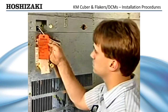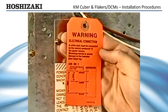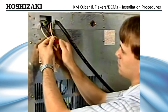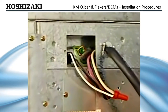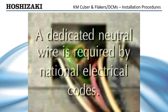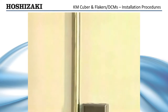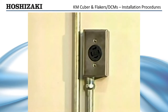When making the electrical connections, it is important that they be made in accordance with the instructions on the warning tag provided with the leads in the junction box. Make sure the white leads are connected to the neutral conductor of the power source. To prevent possible electric shock or damage to the machine, be sure to install a proper ground wire to the ice maker. A separate power supply or receptacle is required for the installation of each ice maker. Be sure to check the nameplate for proper capacity.